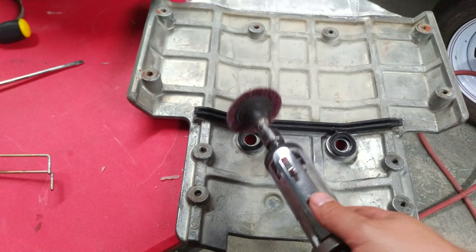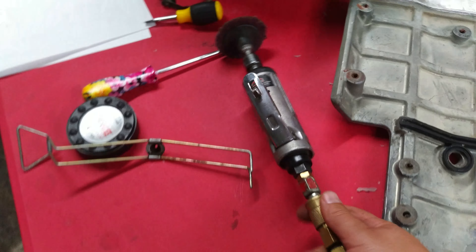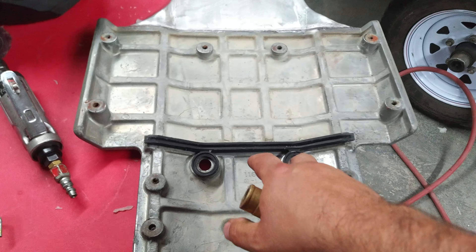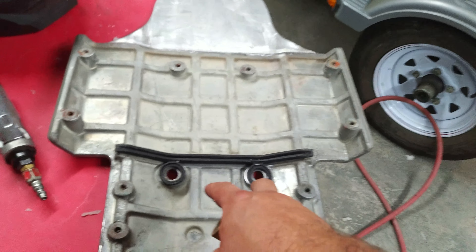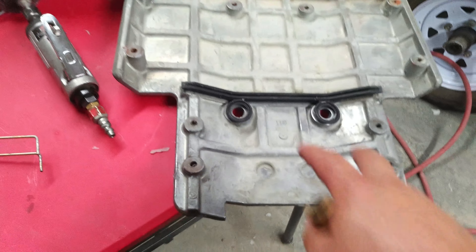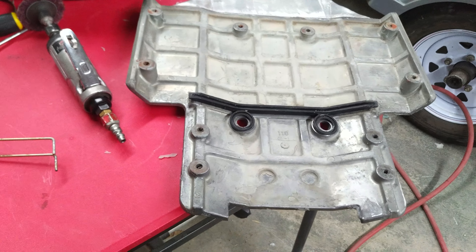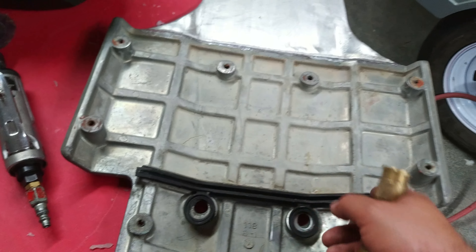I talked with some guys about plugging these holes and not plugging them. My understanding from the Kawasaki 1100 ZXi is that they put these holes in because the jet drive pushes water out through them — they weren't very stable at high speeds. So they added these holes for the 1100 ZXi, and I guess this carried over into the Ultra 150 and the 1200. Some guys say plug the holes with silicone, but if there's pressure pushing water out I think it's going to push the silicone out. So for my purposes I'm going to leave the holes open and silicone around them — here, here, here, and here.